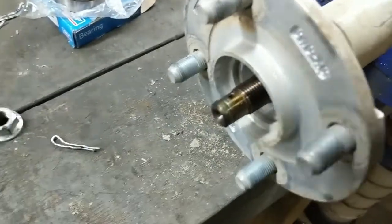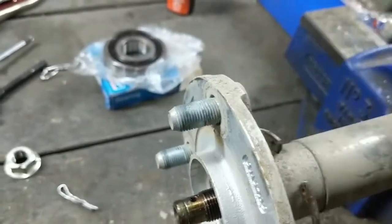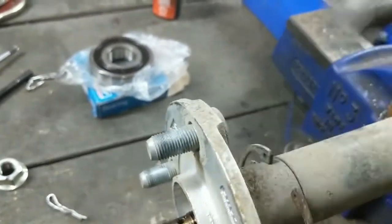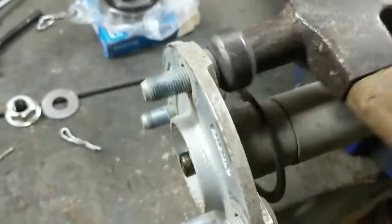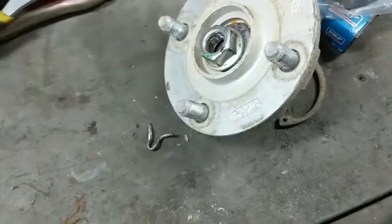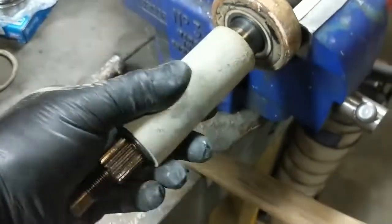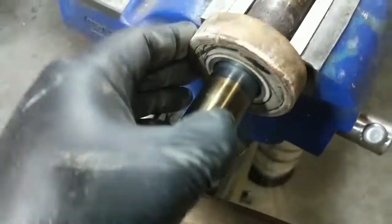Just like that. Now we're going to take a hammer and remove this flange - and there it goes. So that's our clip, that's our flange. As you saw, the washer fell out, the nut, and this is our pin. Here's our assembly - this slides off, and then this here is our bearing which slides off, but we need to press that out in the press.